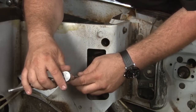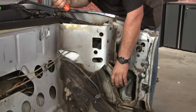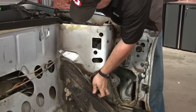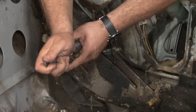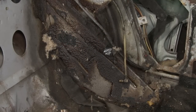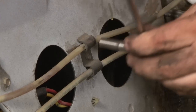Now we're going to start removing the bolt that holds the cylinder into place. We've got a pry bar in there and we're going to gently pry it away from the bracket. Now we're going to disconnect the hydraulic lines from the hydraulic cylinder. If you still have fluid in the system, you'll want to use a drain pan. In our case it's already all over the floor, so we're just going to take our fittings off. We're going to replace one line at a time, starting with the one on the front here and disconnecting it from the motor. Now to remove the line, we're going to loosen up these two brackets.